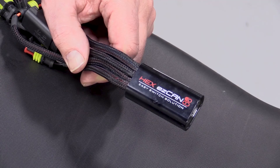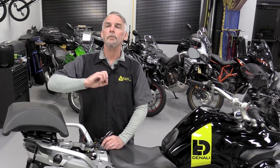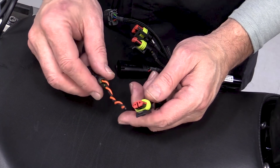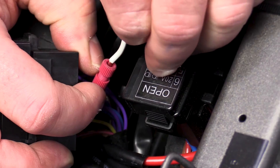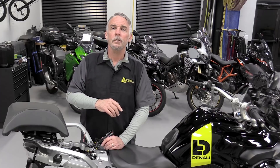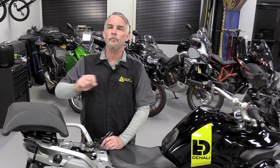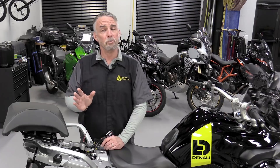Now let's look at the EasyCan. It's designed more for the do-it-yourselfer, someone who's comfortable with wiring. Each EasyCan comes with stubby wiring pigtails for connecting the accessories. From there it's up to you to figure out how to make the connections, whether that's using off-the-shelf connectors like positive splices or something else. Originally the EasyCan used two-wire dimming, but as a rolling change, the device now supports three-wire dimming on all applications — but it can still dim lights that have only two wires.